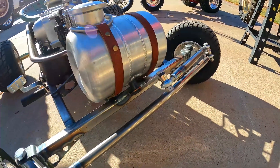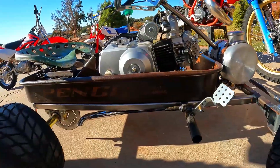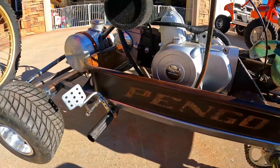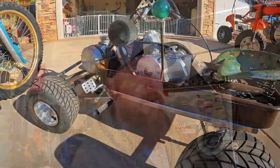Project number three is honestly one of my favorite projects we've ever done — it's so out of the box: the hot rod rat rod wagon. It's got a Chinese pit bike motor in it, a 100% homemade chassis built here in the DBF garage with a bunch of Amazon parts. It's an absolute riot, but I found a small flaw on our first test drive — you can't keep the front tires on the ground. I've got to stretch the frame a little bit and move the rear axle back to distribute the weight forward. If that's your choice, comment down below.